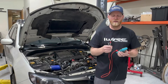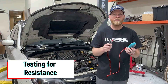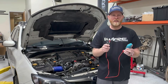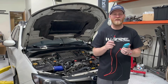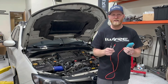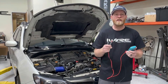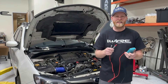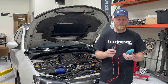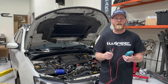The first thing we need to know about is resistance. Resistance is how well something touches something else — yes, this is oversimplified. The point is that resistance is how we test for continuity, which is what we care about: does one thing touch another thing? The higher the resistance, the more something is in the way and the less likely it is to be making contact. The first step is to calibrate — we're going to find out what good resistance looks like.